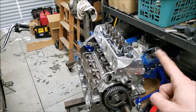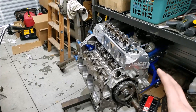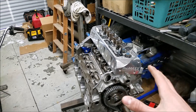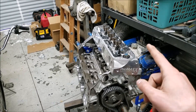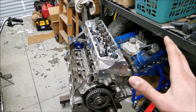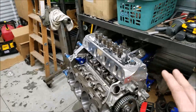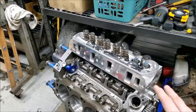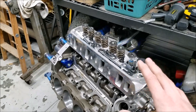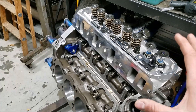I know you're going to want to ask about these cylinder heads. Basically they're a budget unit — the whole idea behind this Mabco deal is budget performance while keeping reliability. These are from Skip White Performance out of Tennessee. They come in as bare castings, and Skip White does all the machine work. All your valve stems are the same height, which you'll see why that's important in a minute. I got both cylinder heads for just over a thousand dollars — about $1,030.